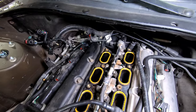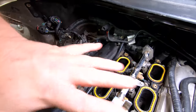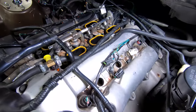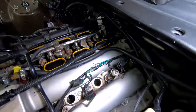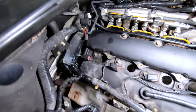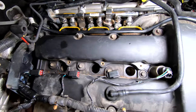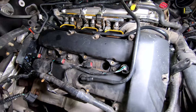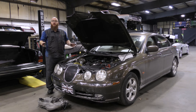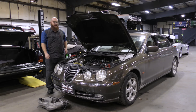It still had a very slight misfire when we had everything done. Now we get to dive in on this — we're going to put all new plugs, all new coils, new plenum gaskets. We know the injectors are working and the compression is good. Tune-ups can be very expensive. Now that we've got this massive intake out of the way, you can see where the coils were — on one side they're easy to get to, but on the passenger side they are not, though they are now because the intake is out of the way. That's why customers sometimes ask why it takes so long to change out plugs. There was one final last issue on this S-Type: the misfire. I'm glad the customer allowed us to go ahead and solve that. We'll get this taken care of, and finally all the issues will be done in one week — not six months.